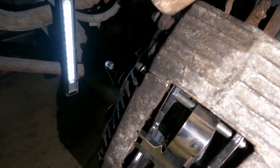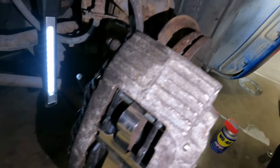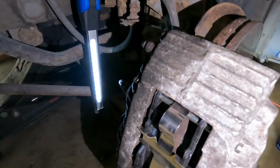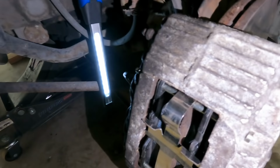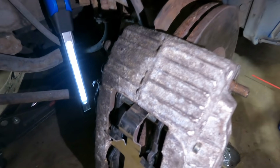As soon as you crack open this bolt right here, which opens the line to your reservoir and leaks out brake fluid, you can do that to soften up the piston so you can just push them down with a finger. But at the end of the day, you're going to have to do some more work at the end, because you got to remove all the air, you got to put more brake fluid, you got to go through a procedure, you have to do this a couple times from the top, you got to do this with every single caliper, which is very annoying. All right, it's extremely annoying. So do my way, it's much better.